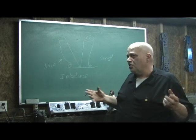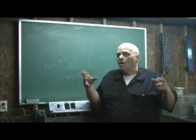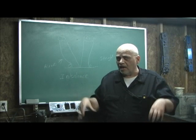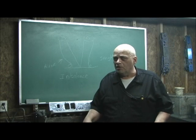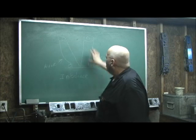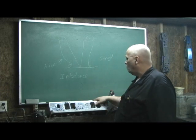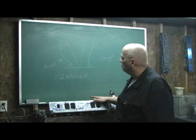When I say balanced, what I mean is looking at the seats of both valves and the opening and closing times of the camshaft - the amount of volumetric efficiency and air and fuel when the valve closes that's in each one of those cylinders. That's what I'm referring to. Not mathematically balancing out each runner, whether it's a straight or a hook, although that is in there, it's not the purpose of it. That's probably getting way above what I'm ready to show y'all.